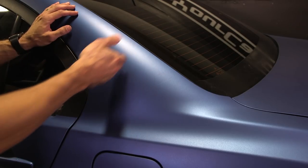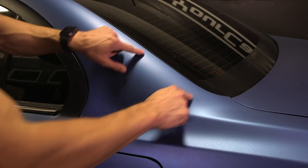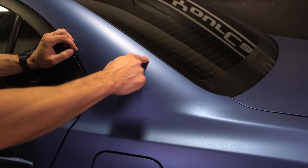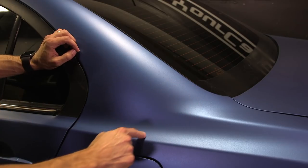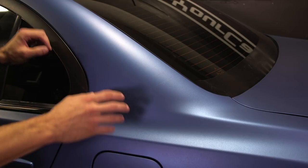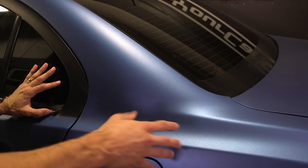If you mask a box around the scratch area and do those light coats, when you remove the masking you're going to see the outline of that masking in the spray — and we don't want this to look any different than the rest of the car. So Gabe's going to come in and help mask off these windows, then we'll move on to the next step.